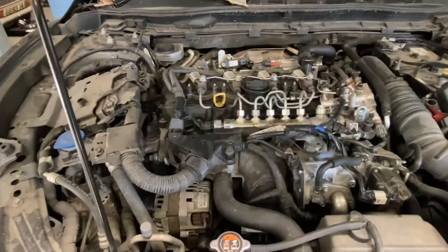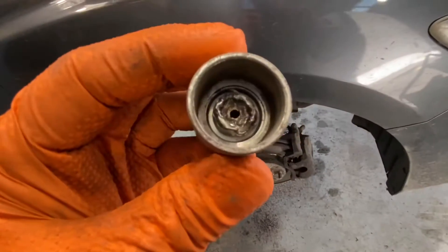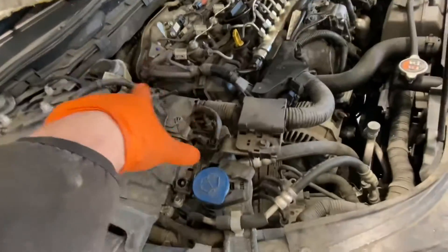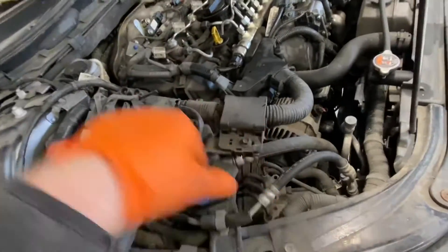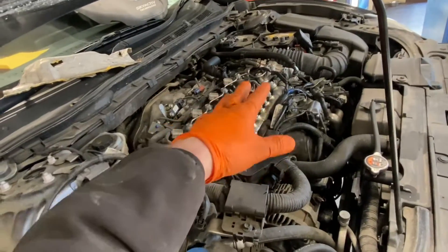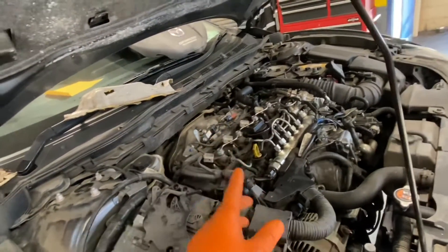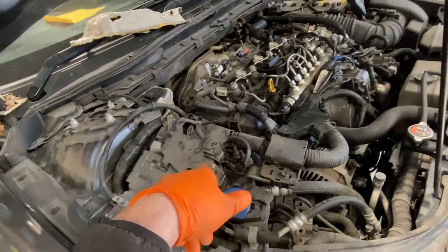At this point we have to make a choice on where to start tackling. Probably going to go in here - could be a bad omen because the minute I pull there's a lock nut and it's already in bits before I even start. Not a great start. We're going to pull off bits of plastic, maybe the crank pulley, aux belt. I've disconnected the battery and ECUs and I'm doing a bit of a teardown to see what I can see. I'll pull out the injectors and rocker cover, and I'll probably check whether that turbo pressure pipe is blocked - it's a very common problem.